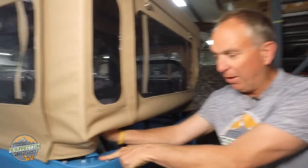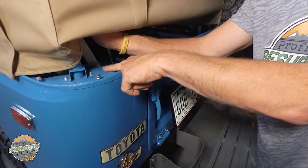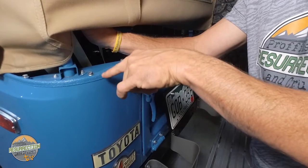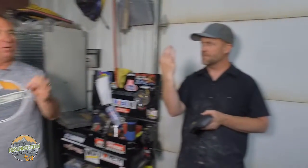And they also had a bracket that was mounted to the floor directly below this — we've moved it to the top of our speaker mount because this is the only place to put speakers in an FJ40. And right here on the face there was a horseshoe-looking bracket that the tube would go through. The loop on the front, the tailgate, and the door hinges are dead giveaways. Factory soft tops also had a seat belt strap that went from the loop on the dash back to a big round head bolt — kind of like a tailgate chain bolt — that allowed the safety strap to loop on. Spectre sells a replica, so now I think we're going to source some straps and put it back in.